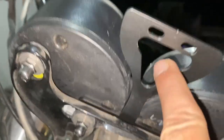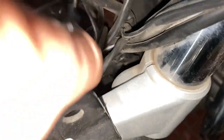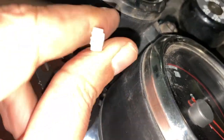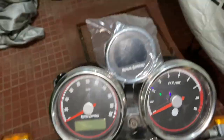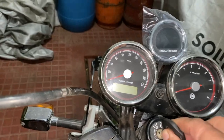What you get is this wire from the auxiliary port which you connect into the yellow-colored aux port. The remaining thin wire, which goes to the pod, should come up from behind through the hole. This wire has come out from the back side and should be passed through so it can be connected to the tripper navigation pod, and it should be secured using the link ties onto these grooves. The connection has been done, and I'm placing the board without the screws just to test it — this is how it looks. Let me fire it up.